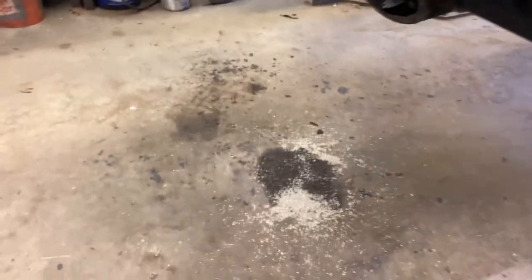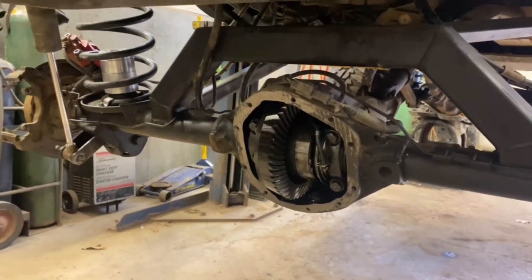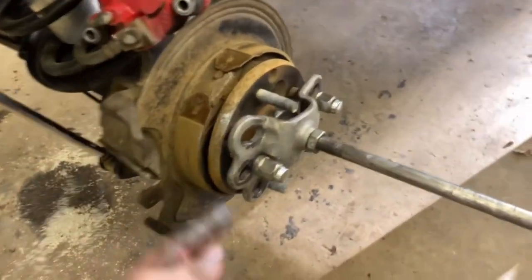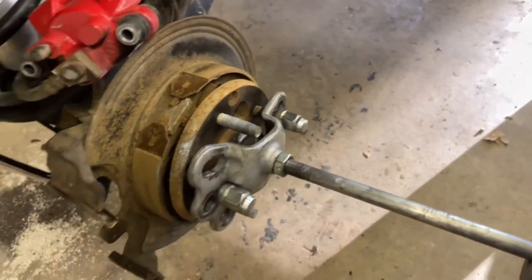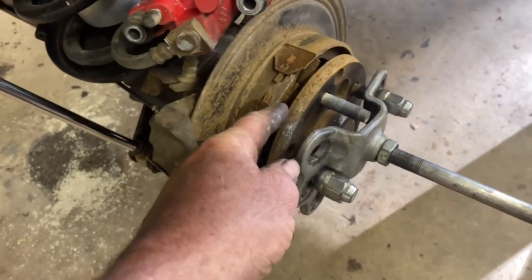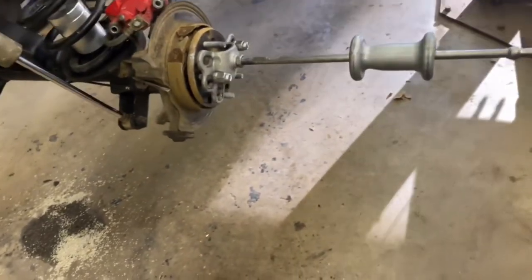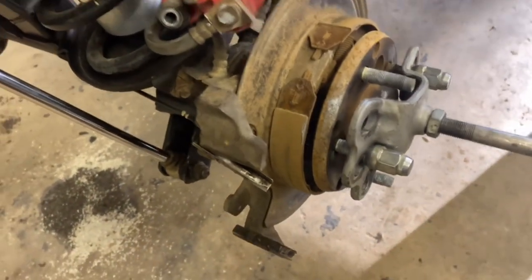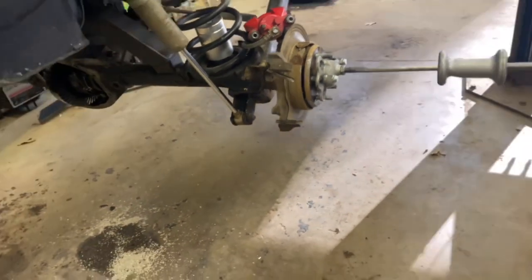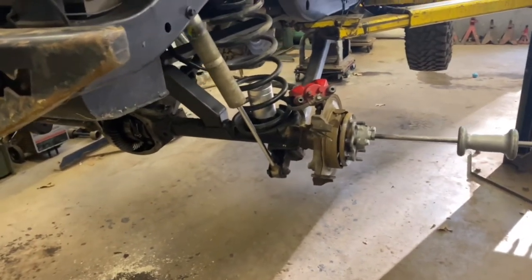I'm not going to get too in-depth on camera just yet because I'm pulling a carrier out to knock the ring gear off and have a look at the diff. Right now I'm getting ready to pull the axles out. I've got a slide hammer on here with a flange adapter — there are four 3/8-24 fine thread nuts that hold a retaining plate to the end of the axle. The wheel bearings on these are pressed onto the axle with a retaining plate, as opposed to a c-clip inside the diff — they're out here, much better setup. I don't have a video assistant today, so I'll pull these axles out, show you what that looks like, get it higher on the lift, and pull the carrier out to see how bad the damage really is.